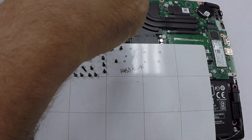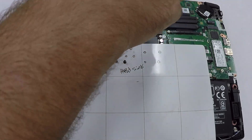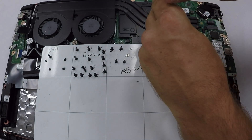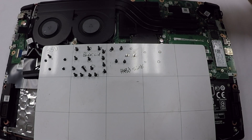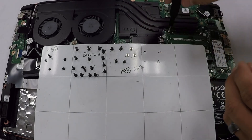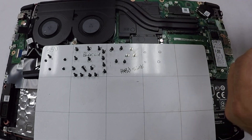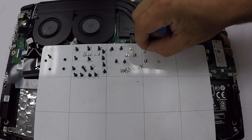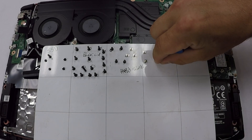I'm putting them on my magnetic board to be safe anyway. Now removing the actual GPU screws — there are only three that hold in the heat sink on top of the GPU. And then the last four screws to remove are the ones that hold pressure on the CPU, which is on the right. When you go to lift the heat sink assembly, put your left hand on the far left and your right hand on the far right, and gently pull up, rotate it towards you, and lay it down on its top side.